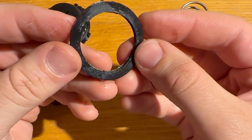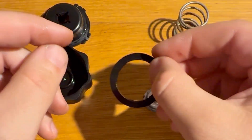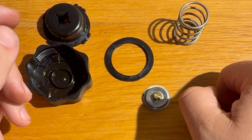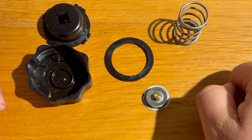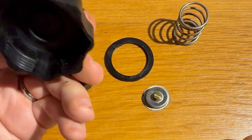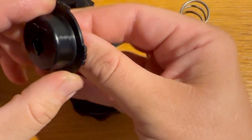Truth be told, I had this cap on the car because I had a few of them as a sample — which were rejected immediately — and they'd been sat on the shelf for some time. I was curious and thought, how bad can it be? There's your answer. A quick grocery stop turned into a 15-minute waiting-for-the-car-to-cool-down ordeal. Thankfully there's no more engine damage than there already is because of the head gasket failure, but it could have been much worse. Unless it's Febi branded or new-old-stock genuine, I wouldn't bother. I highly recommend the Febi cap — every part of it is really well made, the valve is fantastic, and the fact there's no movement in it settles it for me.